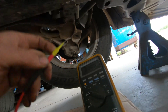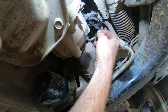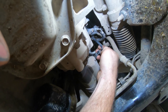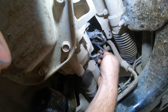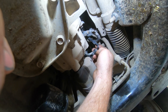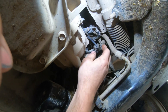So now what I need to do is plug this connector back into the sensor and I'm going to back-probe the connector here. This one has a full rubber weather-pack connector, and what I want to do is try to go right alongside the wire without damaging the weather-pack part of the connector to keep it from having a leak. Because if it springs a leak, you could corrode and damage wires. So I'm going to go ahead and get this thing plugged back in, and then I will show you that scenario.